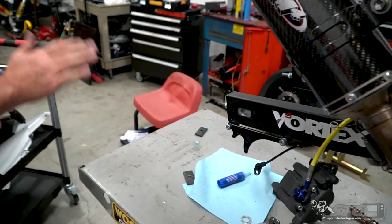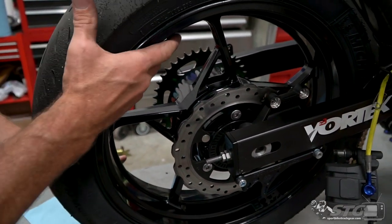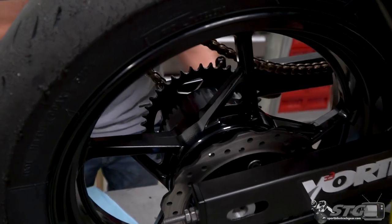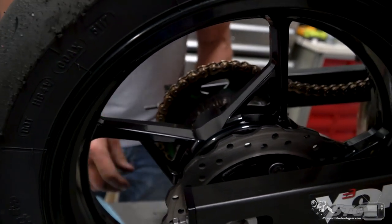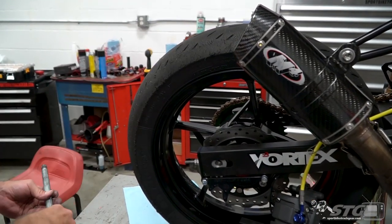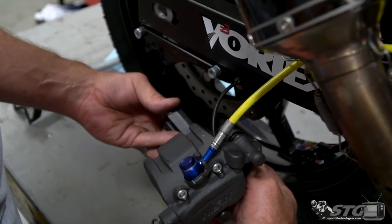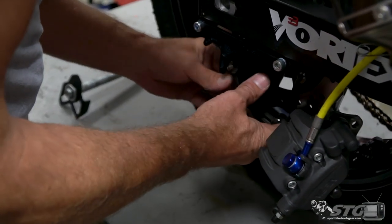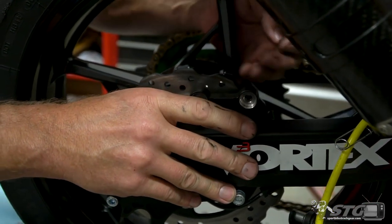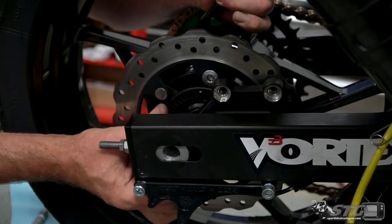Now we'll be ready to slide the rear tire into position. This is going to look a little different because I have the caliper off — I was doing a preliminary look at making that bracket captive. I have a plan, I just need to get a fine 90-degree drill to bring that all to life. I've also reversed the axle on this bike, feeding it in from this side, so all the fasteners — the sprocket and everything — when doing tire changes are on the other side of the bike, which just makes it that much more convenient and less likely that you make a mistake.